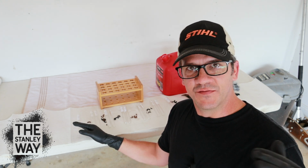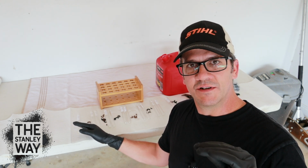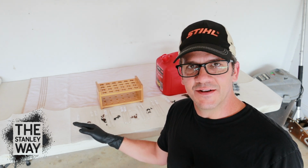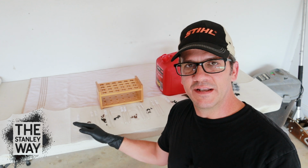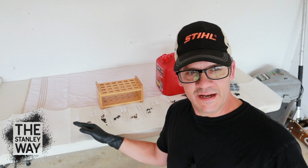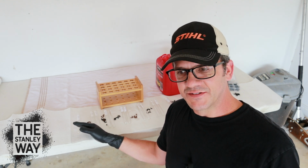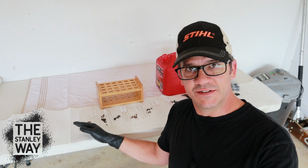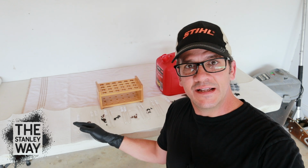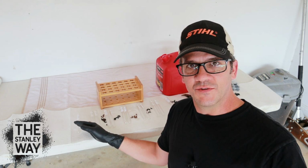It may be worth it to go fill up your tank. If you don't want to try the lacquer thinner, fill your gas tank up with really, really good gas. Maybe add some kind of Techron additive from the auto parts store. Put it in there. Run that sucker at highway speed, 70, 75 miles an hour. If you're mainly doing in-town driving, commuting real slow, that may actually get your catalytic converter hot enough, if it's still working properly, to burn off the things inside the catalytic converter that normally can't burn off because you don't give it a chance to on a small, short drive commute.